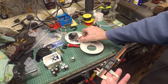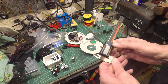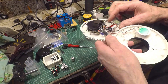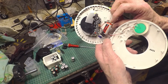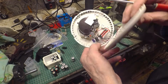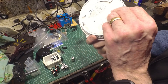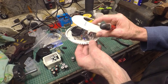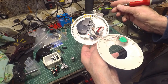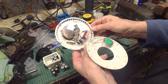It looks like I could put a 3-volt battery in there, because it needs to be that particular type. I could do that and keep this going for another 10 years, probably. I might well do that — I can just solder the terminals in and that should be fine. So it looks as if these 'sealed for life' ST620 Fire Angel alarms are quite easy to open, and it's not difficult to change the battery either. That's good, rather than just chucking the whole thing away. Thanks for watching.